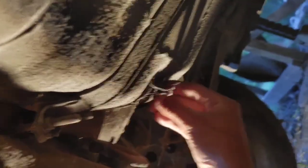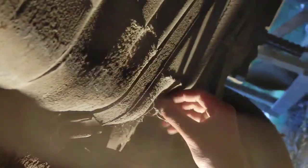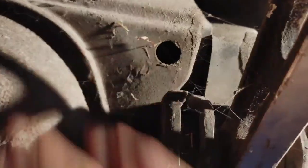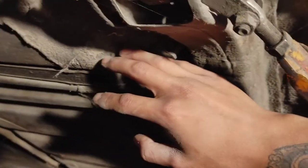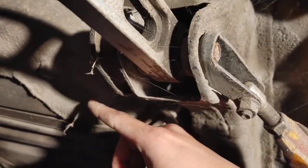Alright guys, so we got Tonka jacked up. We're gonna crawl into here real quick. There will be a 17 right here so you could drain your gas tank. But once you drain it out, what you can do is there are some covers over here, and once you uncover it right here, you can undo the filler neck on the side with a weird clamp, and then that should pretty much be it. Other than whenever you do your fuel pump stuff, you could go into the, I guess, the cabin of the car.